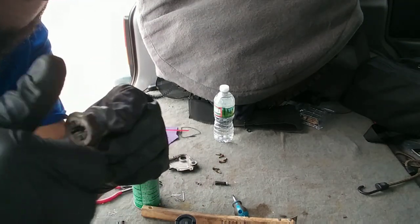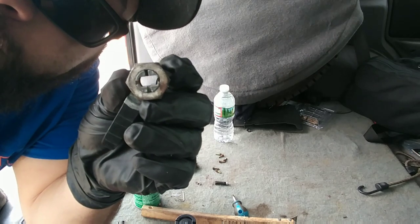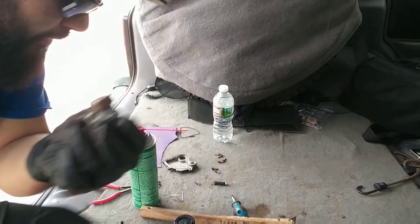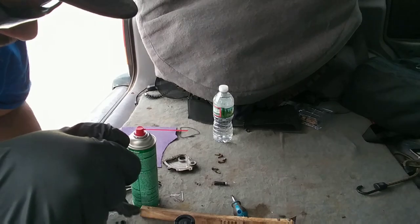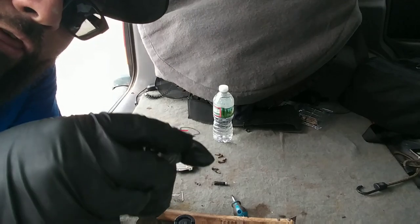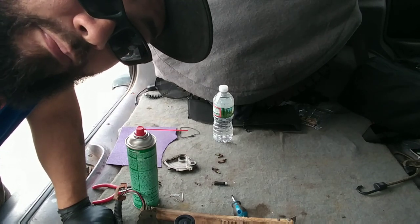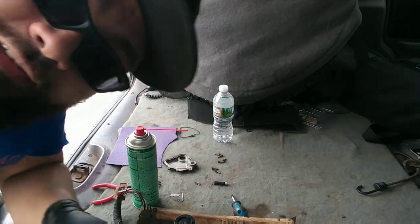This thing goes on here — it press-fits onto a shaft that comes out of the actual transmission. It's a little rectangle kind of thing, you can see it there. What you're supposed to do is loosen it enough so you can get a pry bar or screwdriver underneath to start wiggling the actual assembly off. The problem is the threads ended up splitting off the actual shaft itself, which gave me problems getting the thing out. It's okay now because I can get the nut on there.